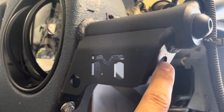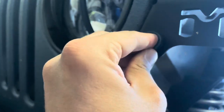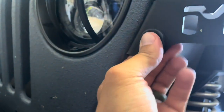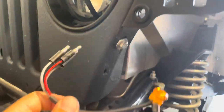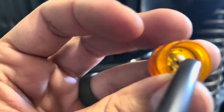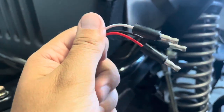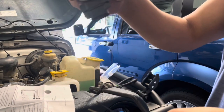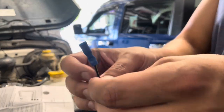On these Metal Cloak fenders you've got two holes on the front along the side for the lights, and they come with little rubber grommets to stick inside — that's what's going to hold the light in place. These lights are LED and they're all epoxied and sealed on the inside, so that should be waterproof. I went ahead and did the first wire after cutting all three off of there — this is a crimp female end of the bullet connector.